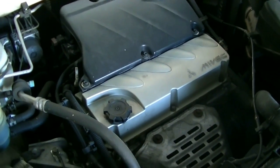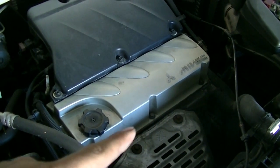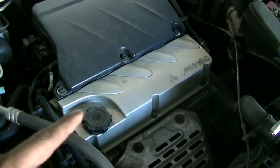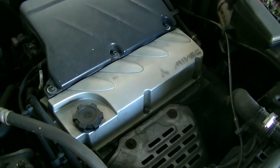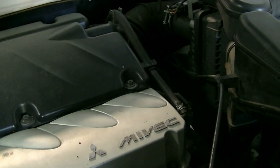As you may or may not be able to tell, this car has a small ticking noise. I've actually rebuilt the cylinder head and replaced all the valves — that's why it's ticking. It should have been adjusted before we put the cylinder head back in, but it was someone else's job and they forgot to adjust it, so now I'm going to do that adjusting myself here.